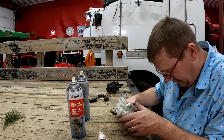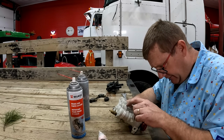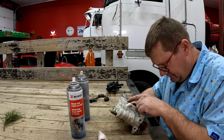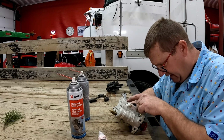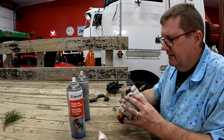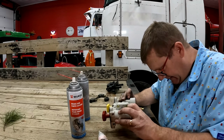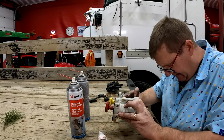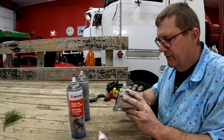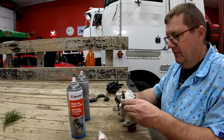So here we've got our delivery trailer, well, Res 1 supply, Res 2 supply. So those are the two supplies. And I think it's Reservoir 1 and Reservoir 2. And then this one is auxiliary supply. And that's actually tied right into this one when you blow through them. And then we've got delivery truck and exhaust.